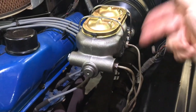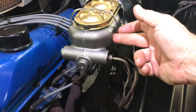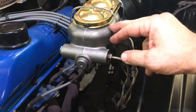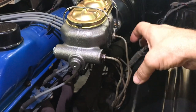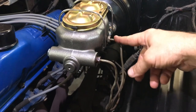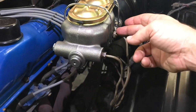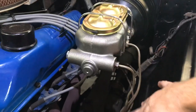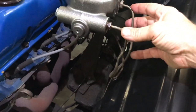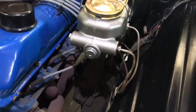My original master cylinder had the large sump in the back for the front brakes and the small sump in the front. This new one is swapped — big sump is in front and small sump is in back. They don't look that different, but I had an adapter on mine to step it up to a bigger size, which I had to remove. Then I had to carefully uncoil some excess brake lines so I could move it forward the eight or ten inches to reach the new master cylinder position.